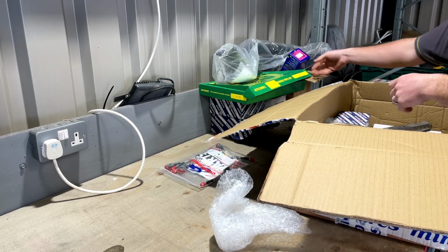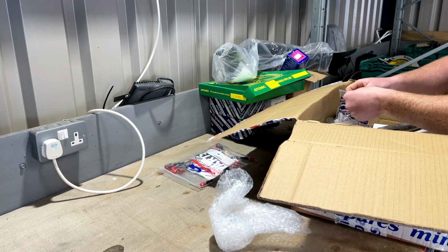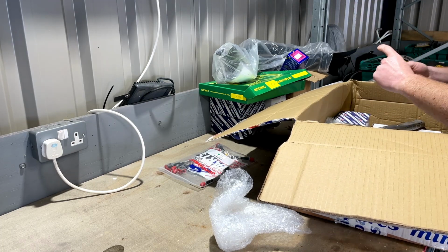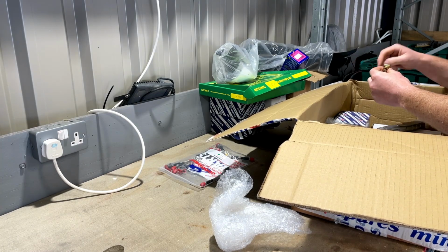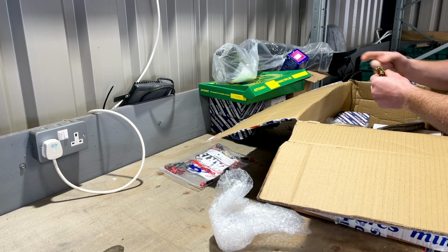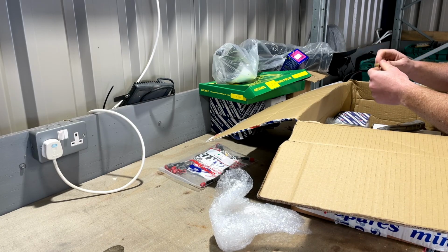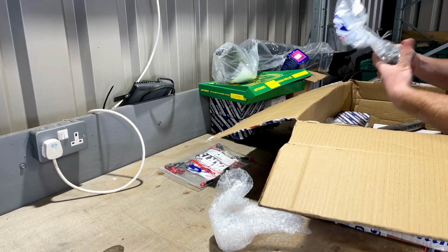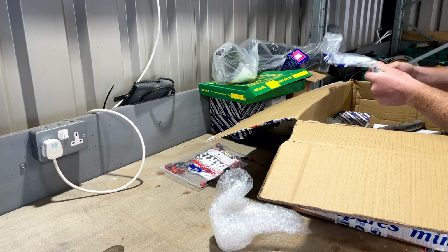Brake pads, very good. T-unions, same deal with them. Obviously, one's for your rear subframe. So it comes in from the front of the car, up under that, passenger side, driver's side, and that's the same essentially from master cylinder into this, and then that goes onto that other one that I showed you a minute ago. Wheel nuts and washers to suit those Mamba style wheels that I've got.